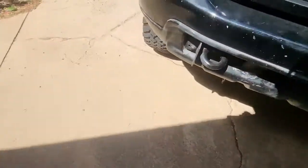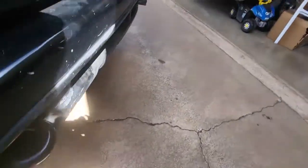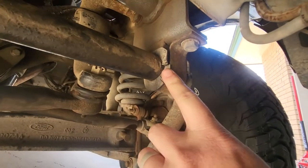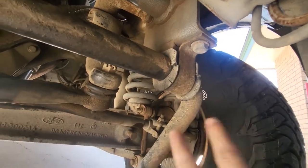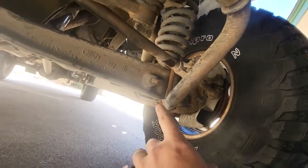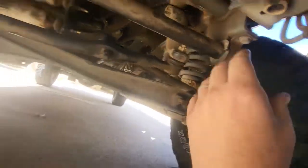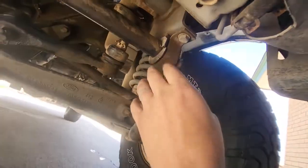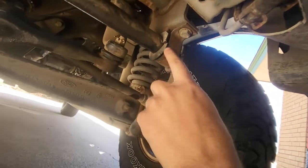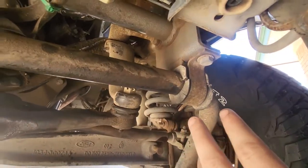These are all one solid piece, and I can tell the reason why this one on the passenger side failed. If we go over to the driver's side — pardon the wind — you see right here there's this little spot where it's split. That's because somebody in the past didn't do this correctly. In order to install these sway bar bushings the right way, I've got to undo from the end links, take this whole sway bar down, and run the new bushings from the ends into the spot where they get bolted in. But you can see somebody took a shortcut and just cut right through here, and that actually causes it to prematurely wear out. So that's why that one failed, and we're not going to do that on the new one.